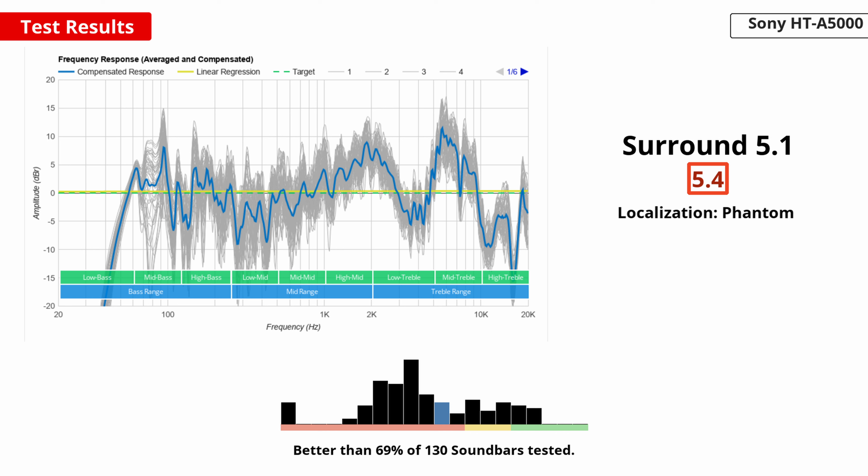If you want to use the soundbar for 5.1 content like movies or gaming, an immersive sound that feels like it's coming from all around you is important. Unfortunately, this soundbar's surround performance is pretty disappointing on its own. Front-firing drivers built into the bar are used to simulate surround objects in the soundstage, but this doesn't sound as clear or as real as discrete localization. For example, in a chase scene, the sound of racing cars just seems to come from speakers placed in front of you — it's not quite as immersive as discrete surrounds, which would actually make it seem like cars were racing past you from a pinpoint location. If you want to improve the surround performance, you can purchase the SA-RS3S rear speakers from Sony separately.